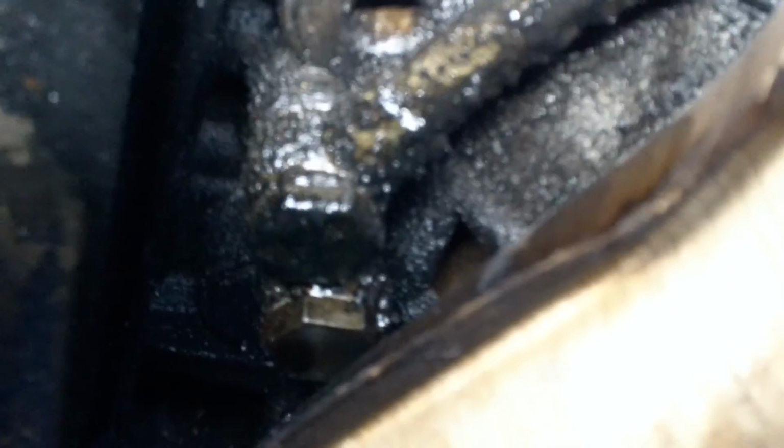We also have some leaks from the transmission area. You can see this is the tranny pan. You get some tranny fluid right there, you can see. It looks like we have multiple leaks. These are the fittings for the transmission cooler lines. We probably want to start with replacing the seals that go around there, and then also the pan gasket itself, and clean this off, and hopefully that resolves pretty much all these issues. It's kind of hard to tell. We're just chasing leaks, so we're going to start with the easiest thing first and then go from there.